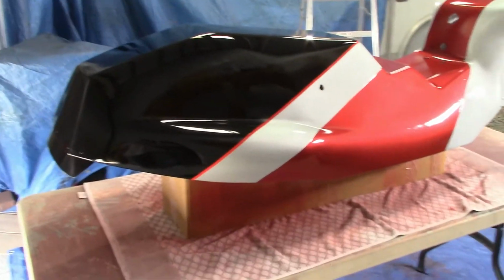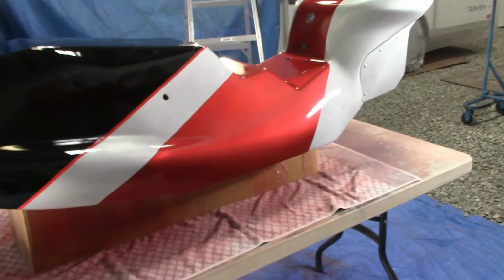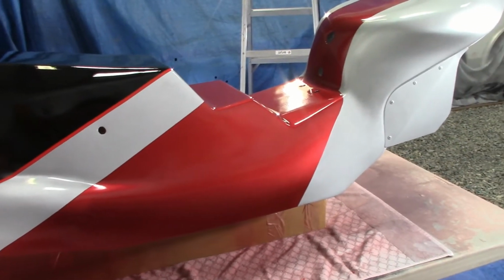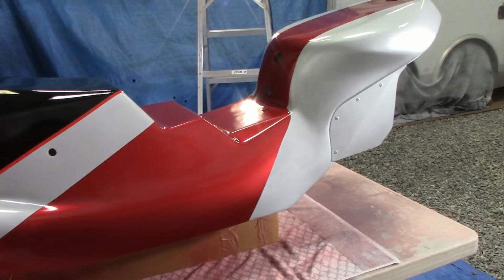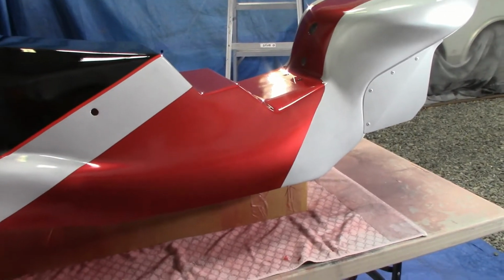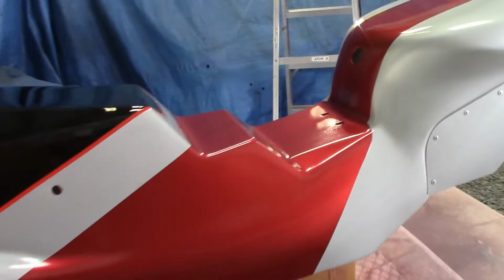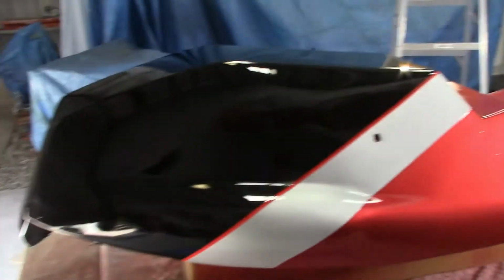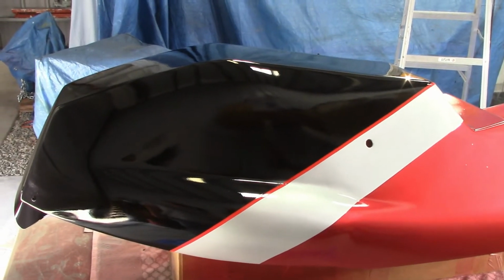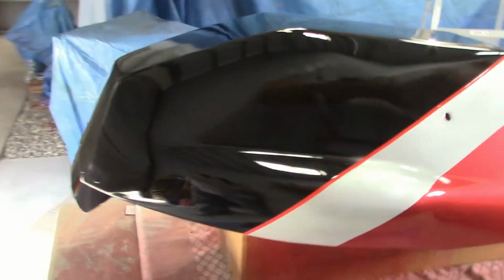Okay guys, this is 2 coats of Spray Max 2K Clear over the Duplicolor Electric Current Red Ford color, and the Duplicolor silver metallic. The red and the silver are an acrylic lacquer out of the spray can. The back section is the Professional Series Rust-Oleum with 50% more coverage, gloss black. That's compatible with the 2K Clear.